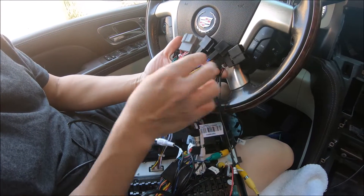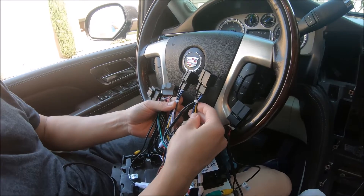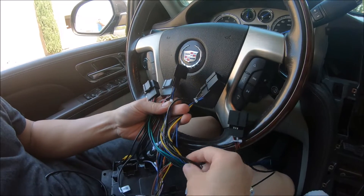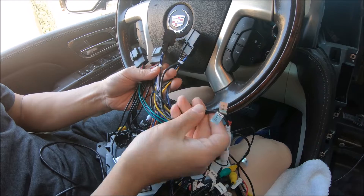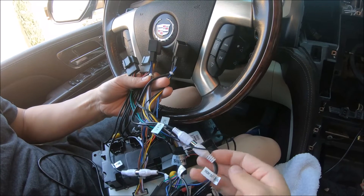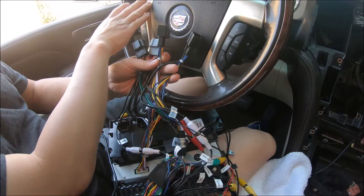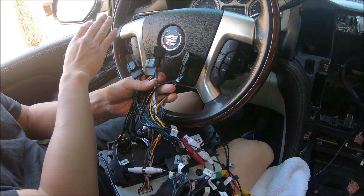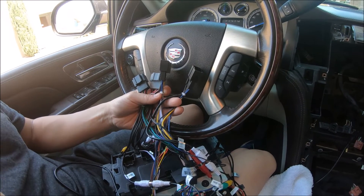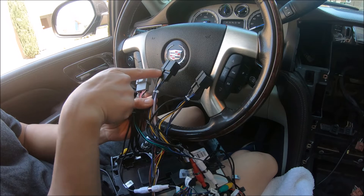The first two are in the center with the thick yellow wire — this is the one for powering the radio. If your vehicle has an amplifier, use the one on the right. To indicate which is the right one: it has two cables that go to RCA FL and FR. This is for vehicles with an amplifier — connect the red and white RCAs to the front out L and front out R, which comes from the RCA connector here. If you do not have an amplifier, connect the connector with no RCAs.